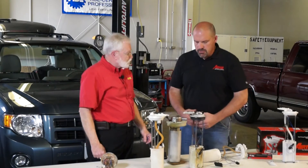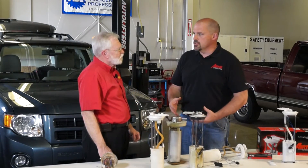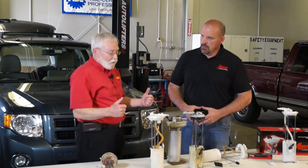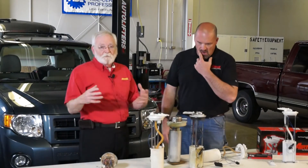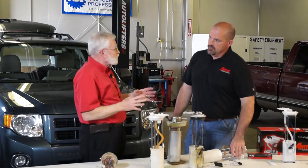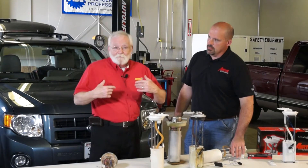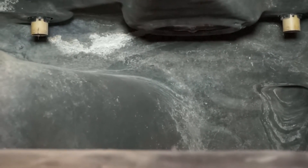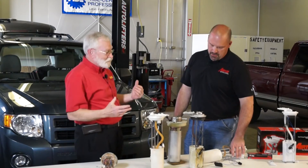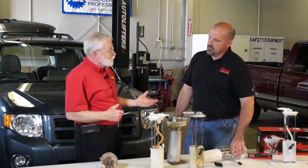In terms of microns, these strainers are usually about a 33-micron filter, so there's quite a bit of contaminants that can still filter through that. So regardless, if the filter is changed every time like it should be, the tank still needs to be cleaned. I've looked inside of the tank and it looked pretty good to me. But as we can see here, way back in the crevices, we can see contamination inside of the tank — and that was a pretty good example of what you can actually see in a tank. And that all has to be cleaned out.